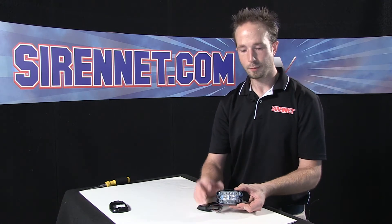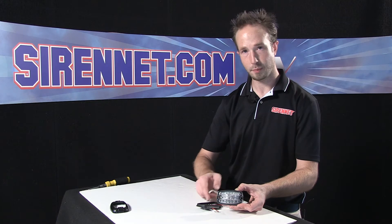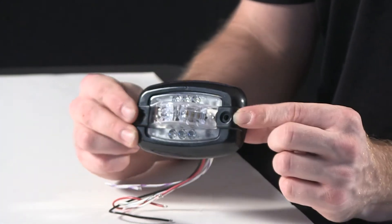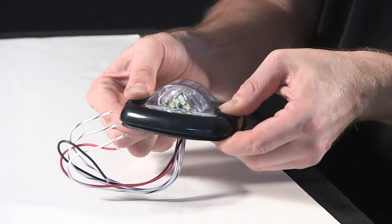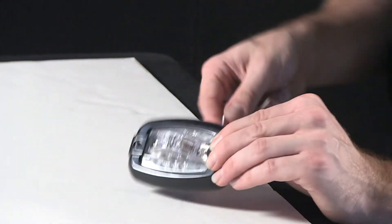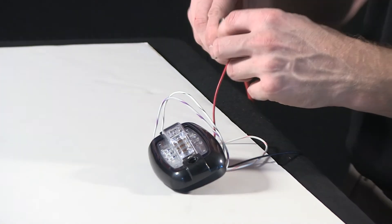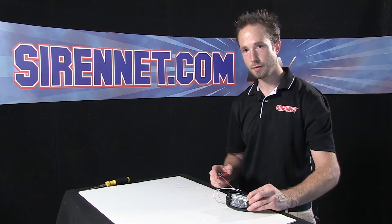Now that I've given you an inside look at the three components of the V23, I'll go ahead and slide the gasket back on, put the flange on the front, and connect the wires to power so you can see how the functions work. When you mount this on your application, you'll use two screws or two bolts through each mounting hole, which will suck the unit onto the surface, making it nice and tight with the flange and lens gasket onto the backing. I'll connect the black wire to ground, and take the red trigger wire and tie it to a positive 12-volt power source. You can see that by applying the red trigger wire to power, the unit activates in its red flashing warning mode.